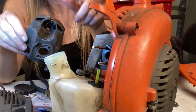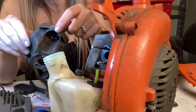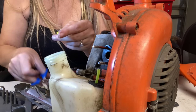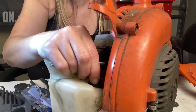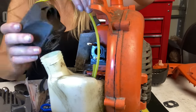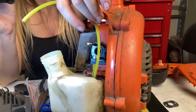The next line going in the grommet is the return line to the tank. It draws fuel from the fuel filter through the fuel line into the carburetor, then sucks it through a line back into the primer purge bulb, and from the purge bulb it goes back into the tank. So this line goes from the purge bulb to the tank. Cut it slightly at a curve, stick it in just about a half inch — it's just a return line and doesn't need to go deep into the fuel tank. About five inches sticking out is what you want.